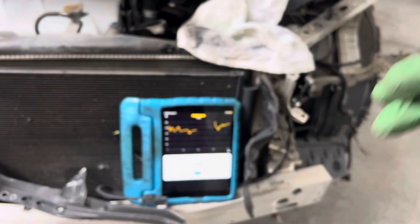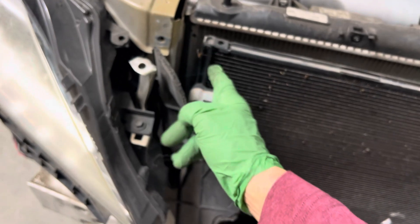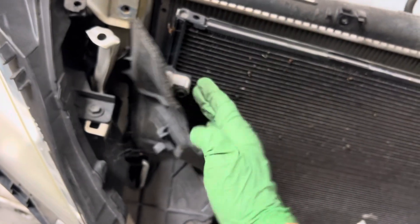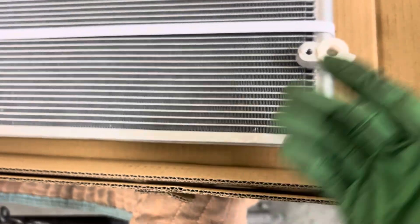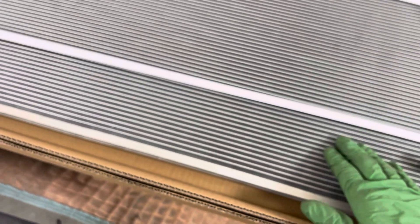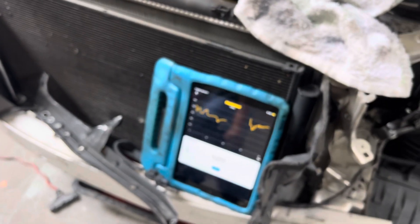The one thing that is different - I know for a fact - if you cut open these fins and tubes with a saw and take a side view of the finnage, how many fins are inside the tube, then come over to the aftermarket and cut those open, you'll see there's about half as many fins on the inside of the refrigerant tubes compared to the OEM.